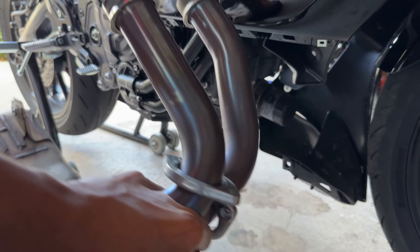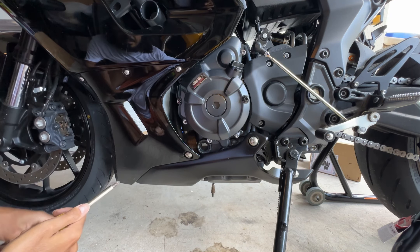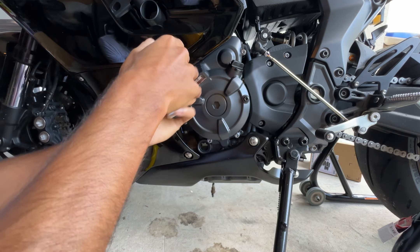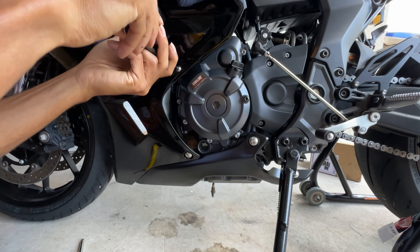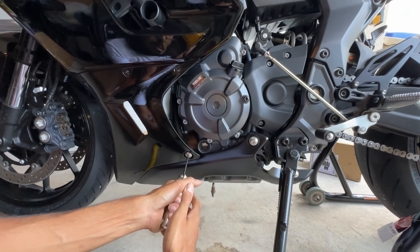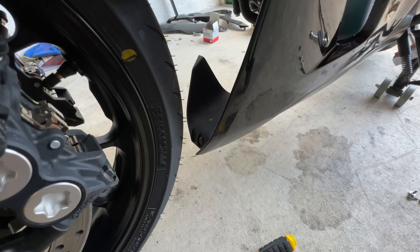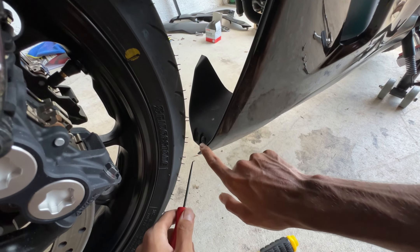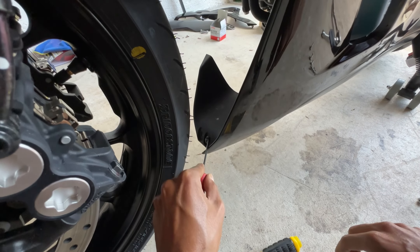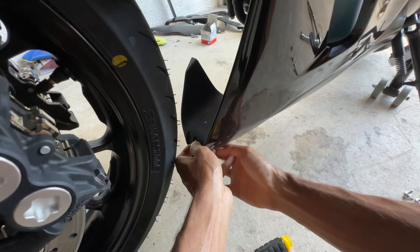This is a heavy one. We're going to go ahead and take the left side panel out now. These are four millimeter allen key wrench screws. There's one, two right here, and there's another one right here. Don't forget you have this pop screw right here — go ahead and get the needle under there and it'll just pop out.